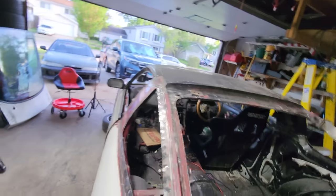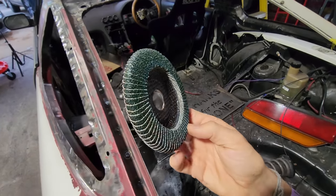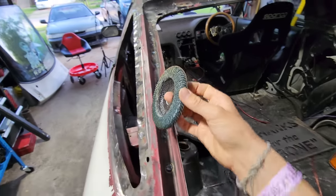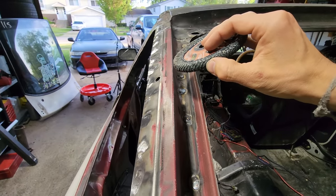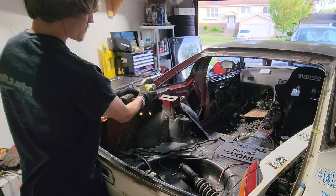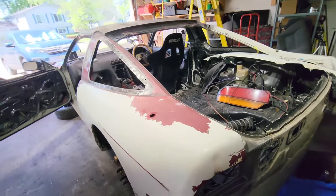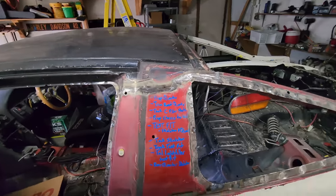I need to start figuring out how I'm going to seal the quarter panel, the inner skin, and the wheel wells — if you have any suggestions please let me know. Next I want to flatten down the welds inside the trunk seam using a special flappy disc that you can use on the edge, which'll be really nice because you can't get in there with a standard flappy disc. I honestly can't lie — this quarter panel came out better than I had anticipated. Everything lines up so well. The door opens and closes without issues.